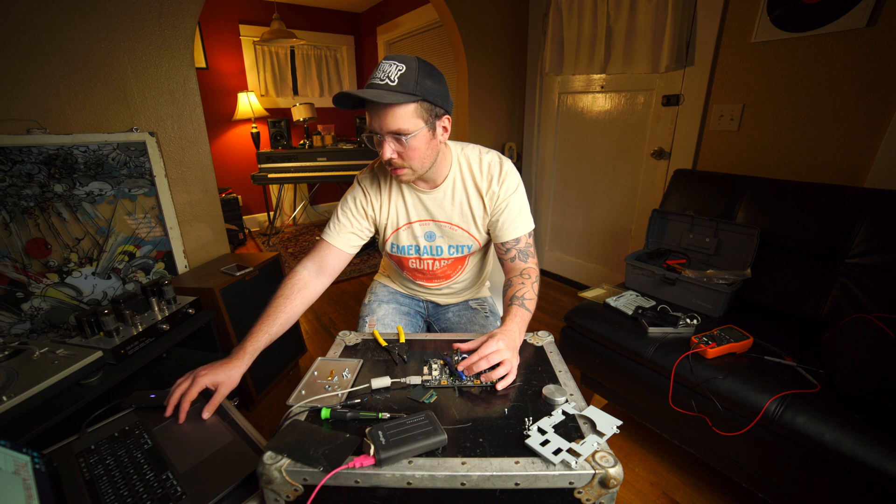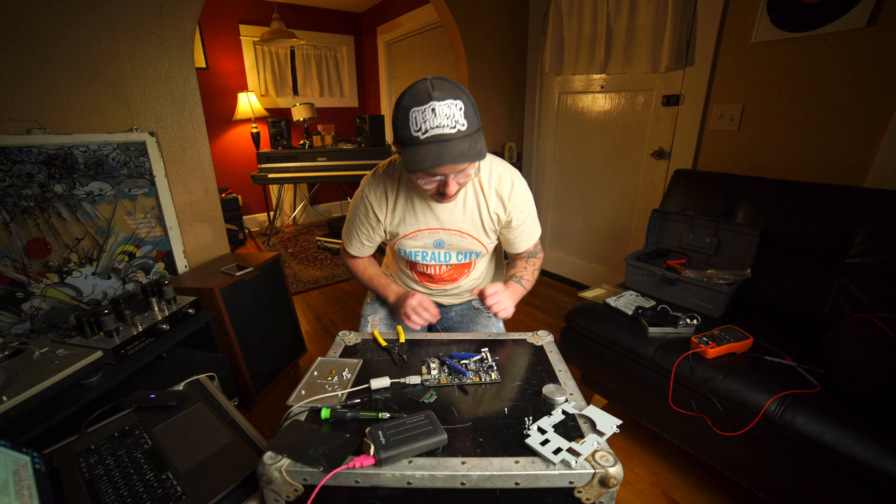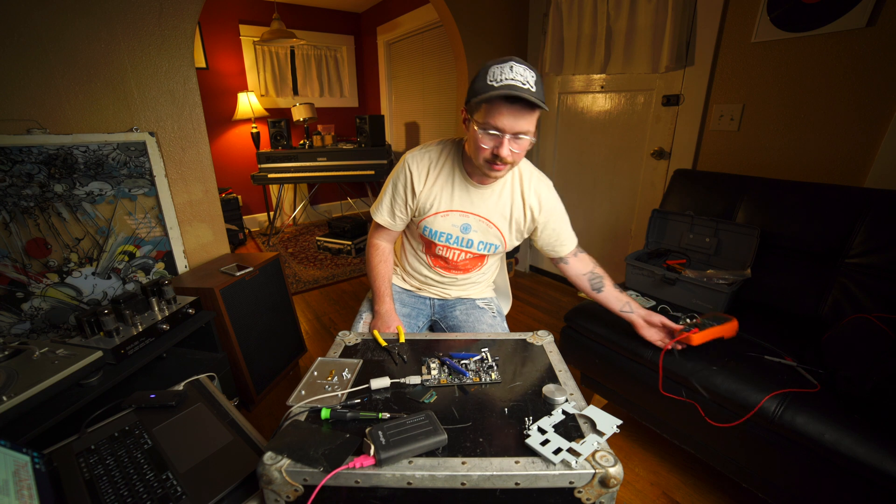I do know that the previous owner replaced this display. So either this was accidentally fried when they were installing it, or there's something wrong with the control module for this display on this board somewhere — I just don't know where that is, because it's not on here. This part right here is just for the capacitive touch sensors, and there's no other circuitry on this board besides that IC right there. So we've got two LEDs — that's a good sign. If I launch the Apogee Maestro control app, you'll see under device output, if I press this button, it still activates the all-channel mute, and this other button would reset the level meters. There are a lot of little pins on here I don't really want to mess with.